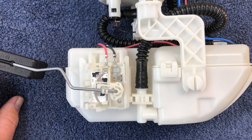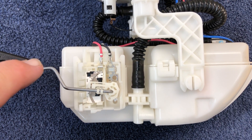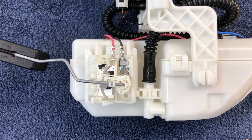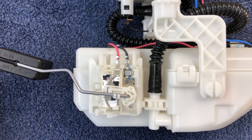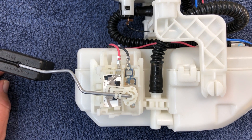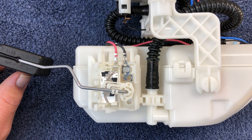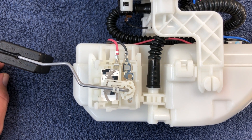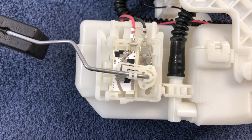You see what I'm saying. The arm being more of a bend here — I increased the bend, I decreased the radius of that bend a little bit. By decreasing that and lowering the level of the float, the gas should push up on it a little higher, harder. And that should theoretically raise that wiper arm just a little bit and give the gauge the signal that the level is higher.